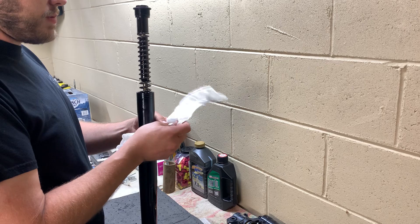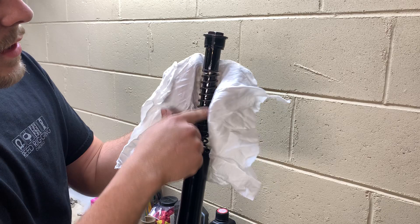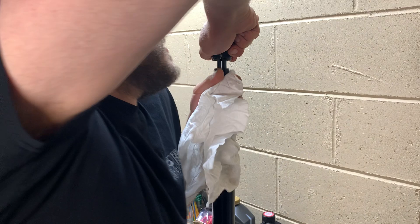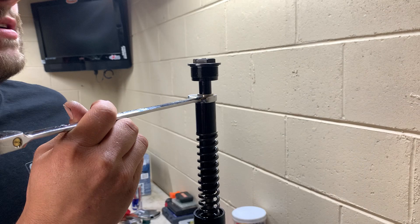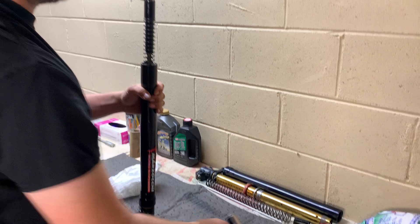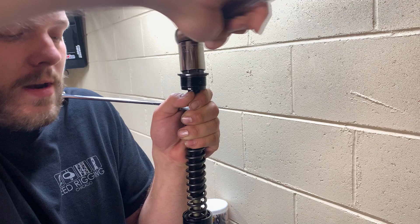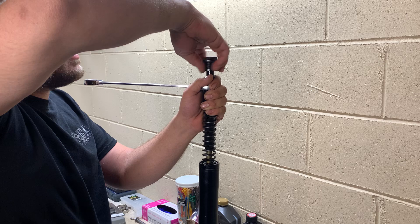This part's a little difficult, especially with stronger springs. You're going to pull down on the spring to create a gap — you'll see why. Get your 19mm wrench ready and close because this is not easy. Pull down and you'll see there's a slot here for a wrench to go in to hold the spring while you do some work. Now that's holding the pressure of everything, so the top cap can be undone. Take your top cap — that one's tight — and loosen it up. Make sure you don't knock your teeth out. I use my neck to hold the wrench on my bench here.